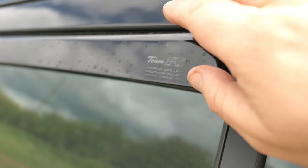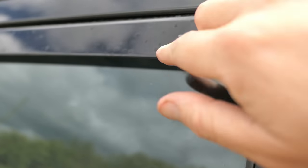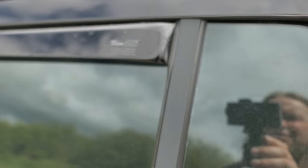Another concern when you sleep in a car outdoors is condensation, so you need ventilation. In the Galaxy we had to rely on having the window open a little bit, and if it rained we'd open the opposing window so rain didn't come in. On this one we decided to get wind deflectors - front and back, about £35 off Amazon. We went with black tinted ones. This enables you to have the window open an inch or two for good ventilation, but if it rains it acts like a lip - so you've got a gap for airflow with rain protection.